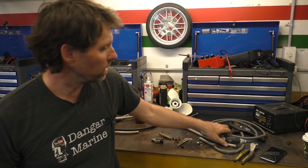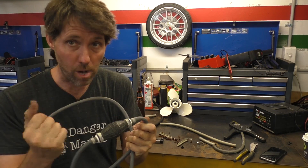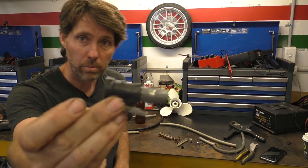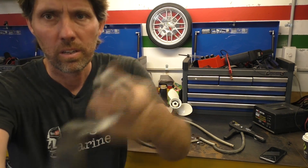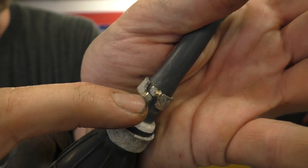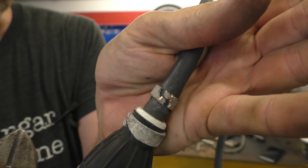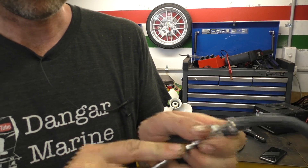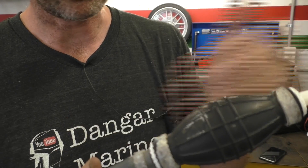There's no real mystery to swapping the lines over — you take the old ones off, you put the new ones on. The only trick can be where old grey line was factory crimped onto the primer bulb and you want to reuse the bulb or fitting. In this case I had a style of crimp that's just pinched up — to get that off, just cut the tops off and it's free. For the style that comes around, grip them and bend them up or get under them with a screwdriver to increase the diameter until the hose pops off. I also made sure there wasn't any debris inside the bulb by flushing clear fuel through it.